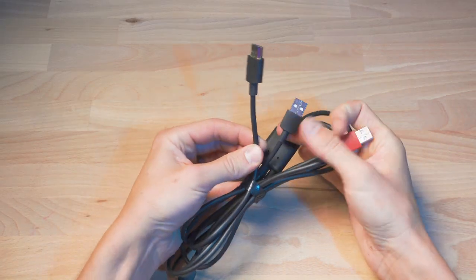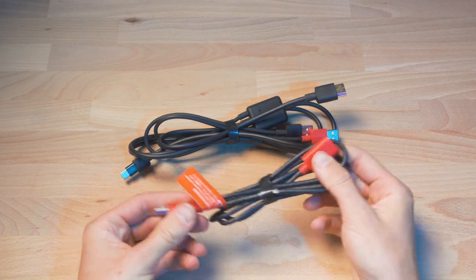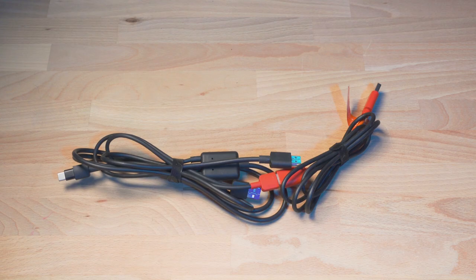And unfortunately, the cables are not that long, so it was kind of difficult for me to get the cable to the back of my computer — which is on the floor behind my desk — and still have it reach to where I want to be able to comfortably draw. I was really excited about the single USB-C cable functionality, but my Puget Systems tower didn't supply enough power, so I was forced into using the three-in-one cable with the HDMI and two USB ports. Even with that standard USB port being used, my computer just wasn't outputting enough power to keep the device on.